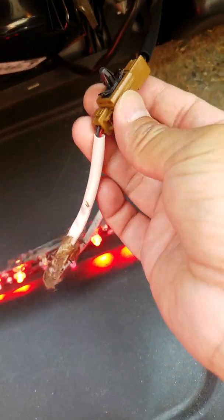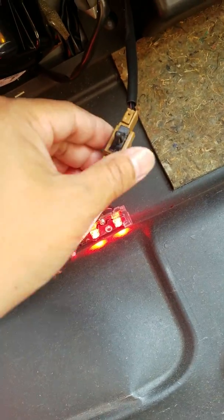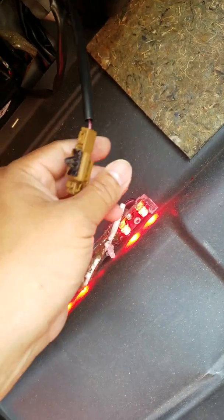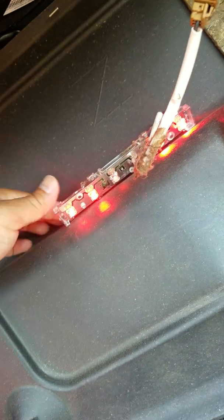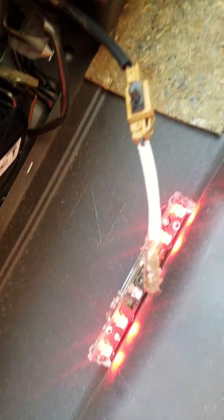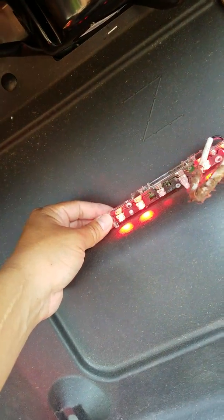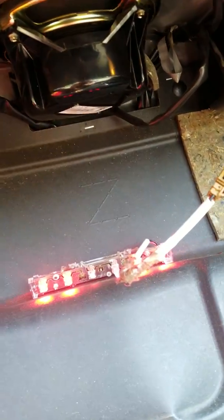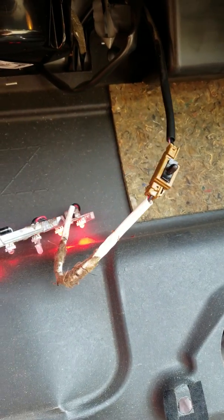I also unplugged the harness because nothing was working. I tested the LEDs without the connector connected and they were working, so I double-checked the harness, changed the diode, added an additional LED, and now it's working. This piece I checked online was $150, and to get to that stupid little screw in the back was a total of $170 — and I did it for a total of five dollars.